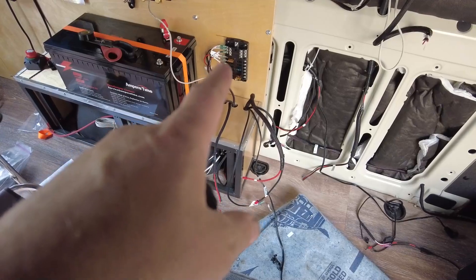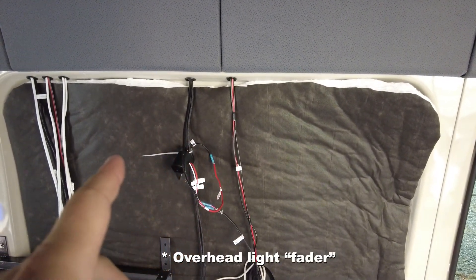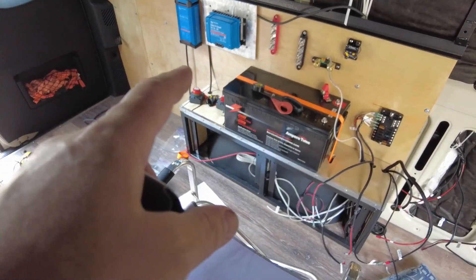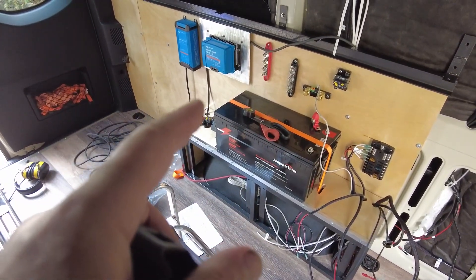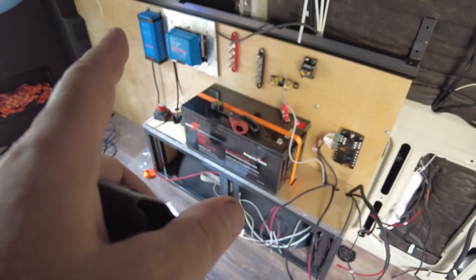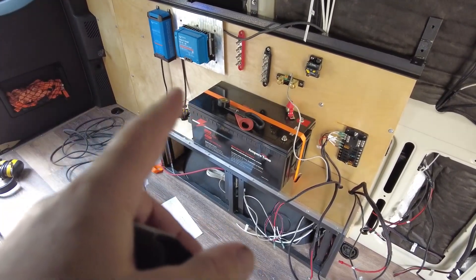The wires needed will pop up through this box right into there. This stuff's all going to be hidden by the panels, but there's going to be a control panel up here with the fader, a thermometer, the meter, and a few other things — some power ports, that type of thing. I've got to install some shutoffs so I'll have a shutoff for the battery and a shutoff for the DC-to-DC charger, so if it's below zero I can shut off the charger so it's not charging the battery. I bought the temperature probe but I'm a little unsure how that's going to work, so for now it'll just be a manual switch.